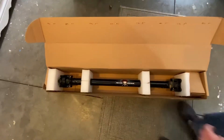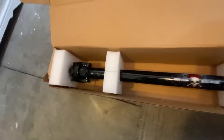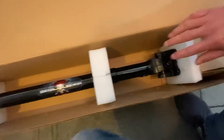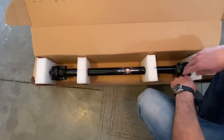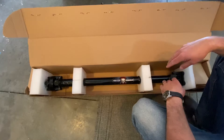This is an Adams driveshaft. It's a 1310 double cardan. It's got the two U-joints down on the transfer case end, and then it's got an OEM flange style on the axle end. We're going to add that to the Jeep today. That should add some extra strength up front, and then it'll also give us some clearance on the exhaust crossmember.